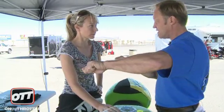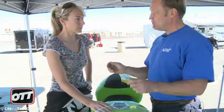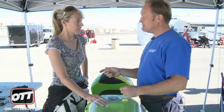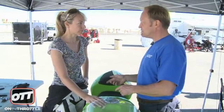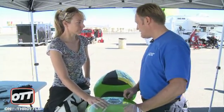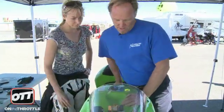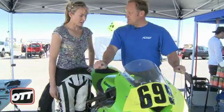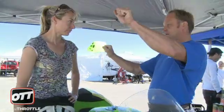We've already had one bike this morning where the front end was tweaked and the bar was in the wrong place, just like this. So you're riding around with it turning easy one way, but not turning quite the same the other way. So the bike is determining what you do, which is not letting you relax, because the bike should do exactly as it's told, and it's not. We'll fix that right away. It's reasonably minimal, but the bar position is a big deal, because if you're riding around like this, it's going to turn totally differently.